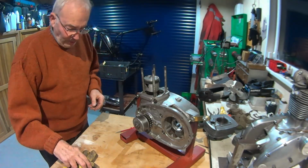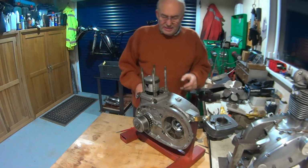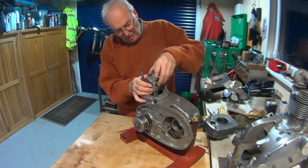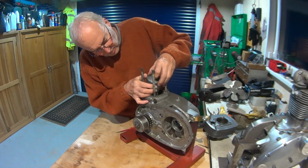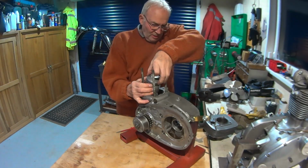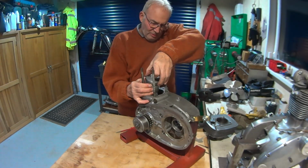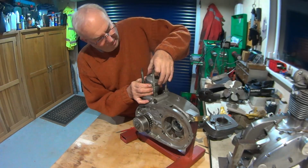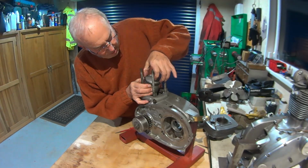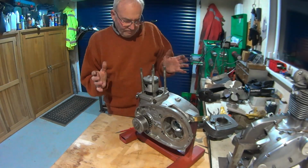Rings are in, so we're looking at 360 divided by 3, 120. So if I put the bottom ring there, second ring there, top ring there, it's going to give me my 120.